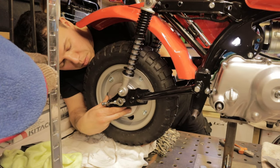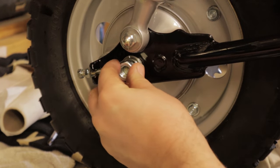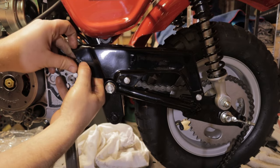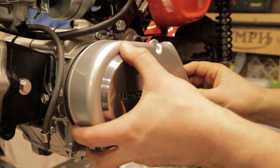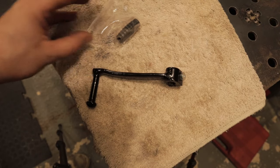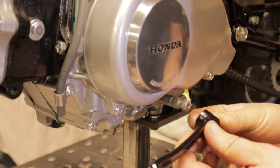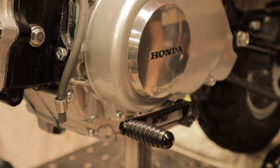Next up is wheel fitment. We start on the rear end, get our spacers in there, get it all lined up and drop through our zinc plated axle. Getting them plated is way cheaper than buying new ones and we get to keep the original bolt. Once you get that rear wheel in it allows you to fit your chain, so with some adjustment on the sliders we reinstall the same chain, and obviously the cover goes back on. Another thing being fixed during this build was the gear shifter — sprayed by hand last time, it's now been powder coated. A freshly powder coated shifter and a new rubber boot go onto the bike and finish off the left hand side of the engine.